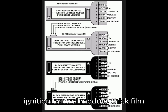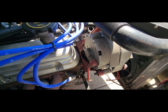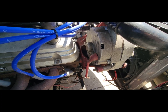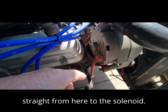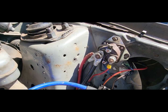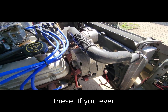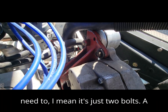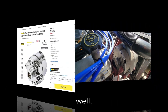Here's a diagram of your TFI ignition control module — Thick Film Ignition. I'm using wire two and three: the coil negative and number three is your run power in. I have a one-wire alternator on it right here; it goes straight from here to the solenoid. I highly recommend these — it's just two bolts to take it off and they work very well.